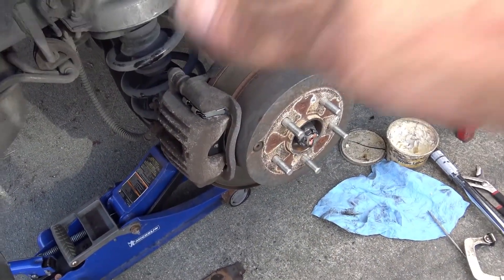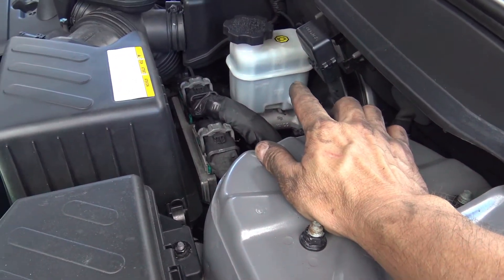What's great about this kit is it comes with new brake pads but also new shims to replace the old rusty ones. We take the old ones right out and the new ones go in. These shims are very similar, except I noticed this little tab is bent at a slightly different angle, making it a little hard to fit. So I'm going to bend it slightly to help it fit in — now it should fit in no problem at all.